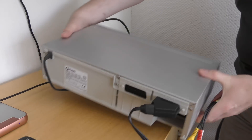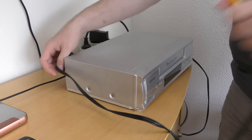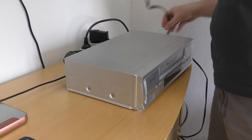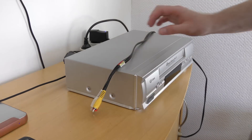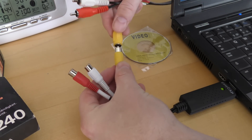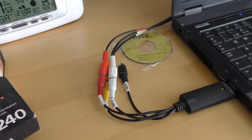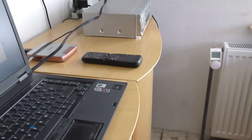We're going for the out signal and putting the video recorder over here. The cable is way too long — that's not good for the signal with old analog stuff, long cables are definitely not ideal. The cable from the video recorder goes in: yellow to yellow, red to red, white to white. Couldn't be simpler. I'm very interested to see if pressing play will show anything on my screen.